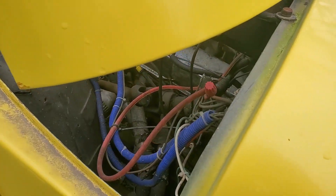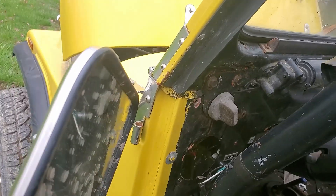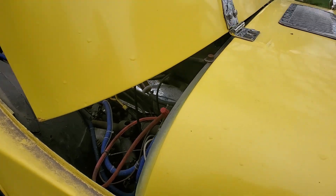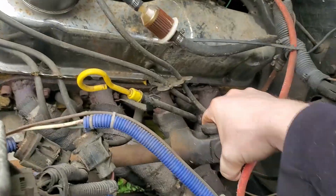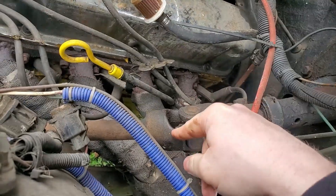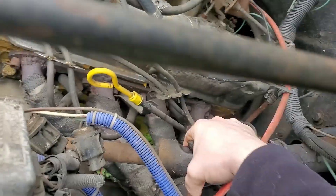Now we're going to look inside of here. See the steering knuckle — we're rotating there. So now we can assume that between here and that point is relatively good. There could be slop in there, but let's just assume from here to there is good. So let's come down here. If you're lucky, you can grab this and rotate it, which we can. There's not a lot of tension in there, so we can rotate it back and forth. We can look here and see how much slop we have in this U-joint because that's just a U-joint with a greasable insert in there. It's not too much, so let's keep moving down.